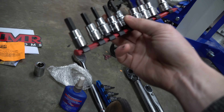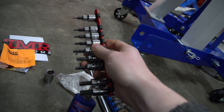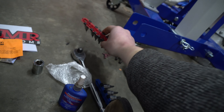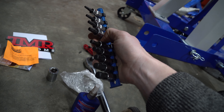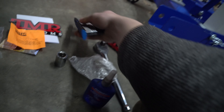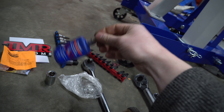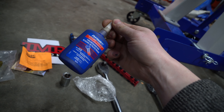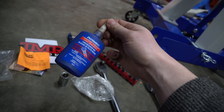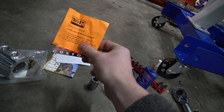Let's jump right into this. Next thing you're going to need is a SAE Allen key set, preferably for a ratchet so you can do your torque specs. Just in case, I'll find the best-fitting Allen key from my SAE and metric sets so we don't strip. Highly recommend 262 Loctite. TMR sells their own brand of it, but I'm just using my Permatex — it is also 262-rated red Loctite, which is what they are asking for on all fasteners.